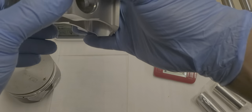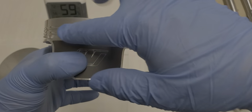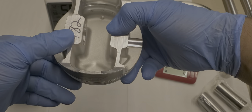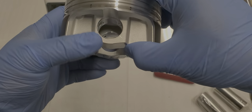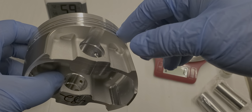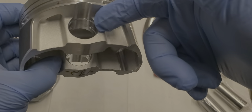The forged Wiseco's approach I thought was a bit more interesting and also expect it to be more efficient. It has three oil holes instead of two on both sides. On top of that, it actually has holes on the side — two on each side — and those holes are oil holes that direct oil directly into the wrist pin housing. I thought that was pretty cool.